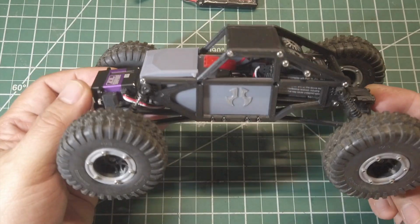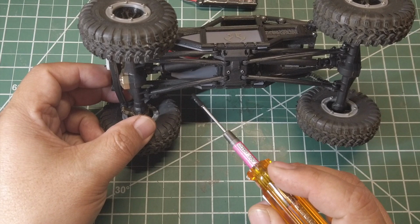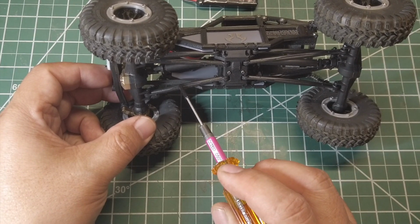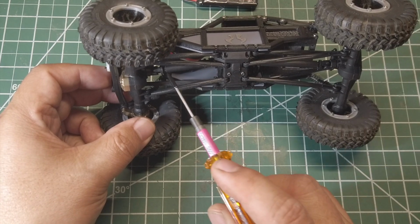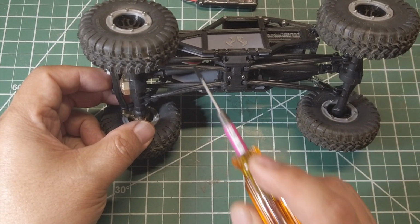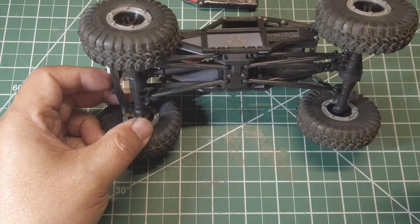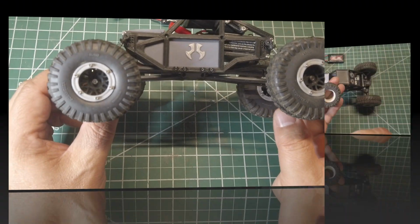In order to address this, I ended up using C10 or Jeep rear links on the front side. Since the rear links are much longer, I couldn't use the upper Y link, and so I ended up converting it to a 4-link setup. In the future, I plan to run the high clearance links.